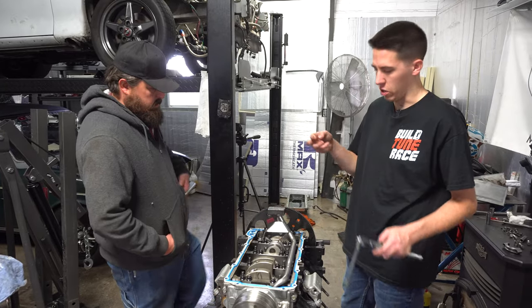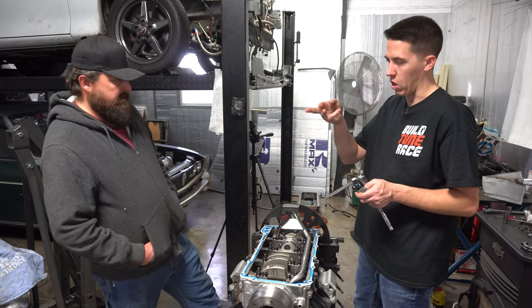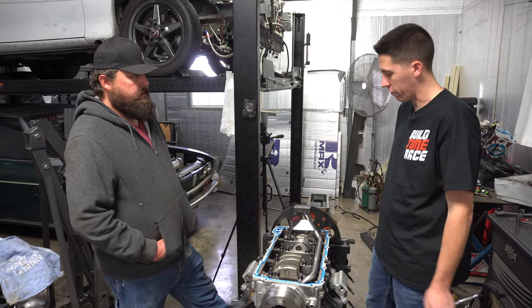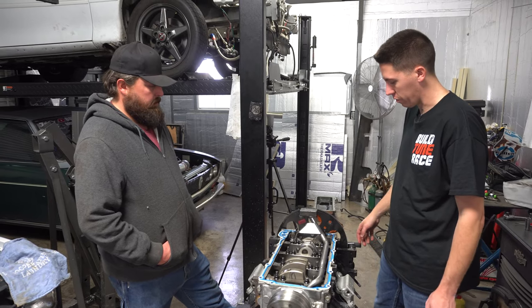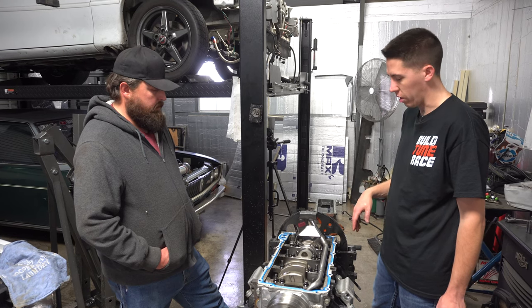I believe all you have to do to go from the black 24X to a gray 58X in the Holley is move a wire and then make it 58X in the software. I'm hoping that's all I gotta do. I gotta do some research, so I'll take this to him. I might tear it apart with him. Maybe I can bring you guys along with me.